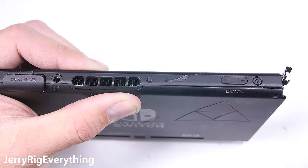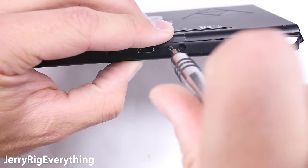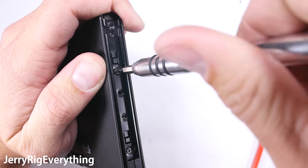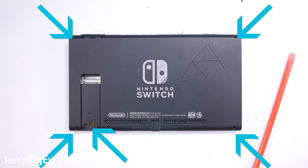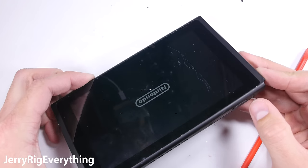The back plastic falls into place with one screw at the top, two more at the bottom, and five screws on either side of the device — all normal Phillips head screws. Lastly, four screws along the back with the little one underneath the kickstand as well. And it looks like everything works.